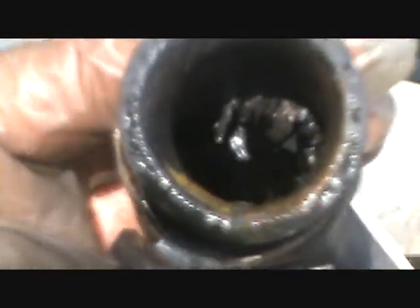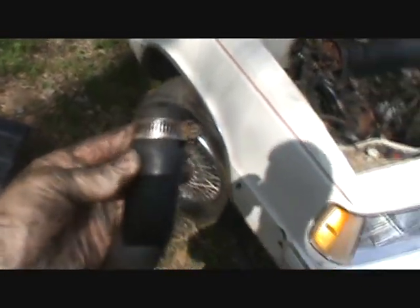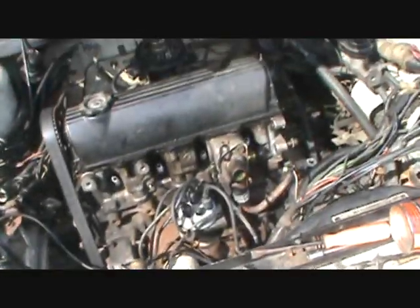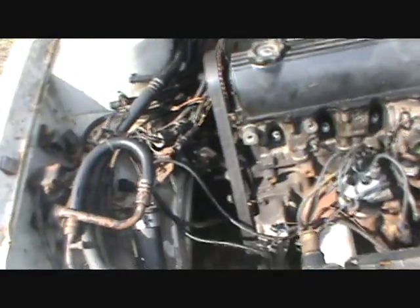Drained the coolant — the easiest way to do it thoroughly is just take off the lower hose where it goes into the water box at the water pump, it drains everything right down. And the upper hose is off too. Take a look at this hose — you ever wonder how bad hoses can get without you knowing it? You can see how gnarly it is inside, with the wire showing. It was soft right where that's happening — it wasn't far from blowing. That hose is gone.